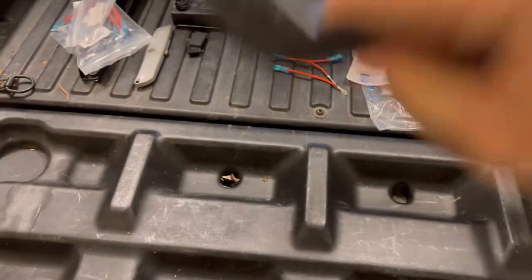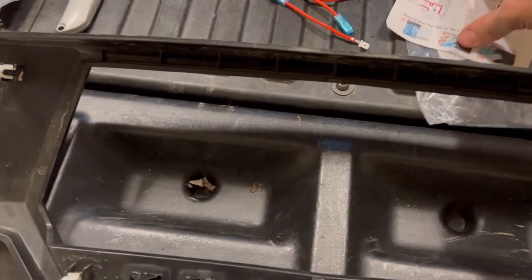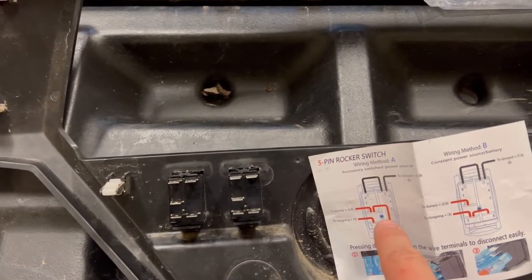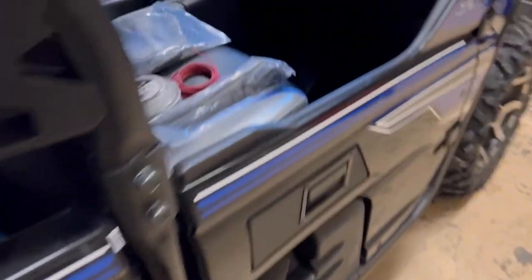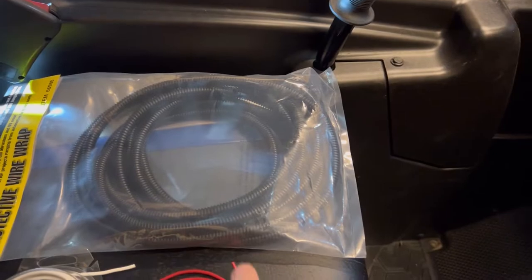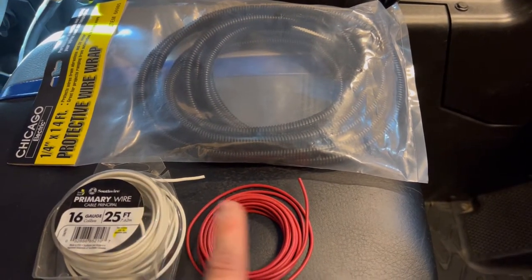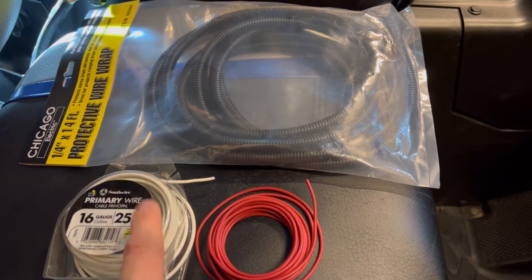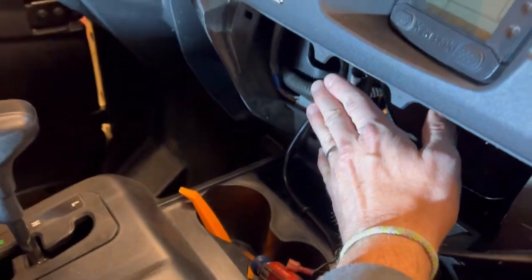Now I'm going to wire these up. There's some pre-wiring I need to do — installing the illuminator kit so the switches will be lit up. This one is five-pin as you can see, so I'm going to wire it per the diagram. After that I have some wire loom to protect the cables. I'll run red wire from the terminal block as power to the switch, then white wire returning from the switch back to the terminal block, then convert back to red wire going to the light, with red and black going to the lights.